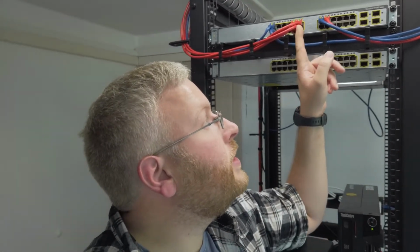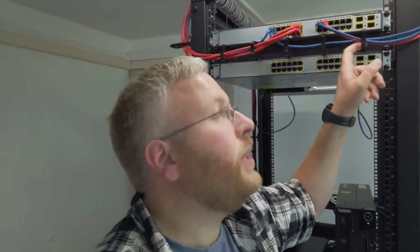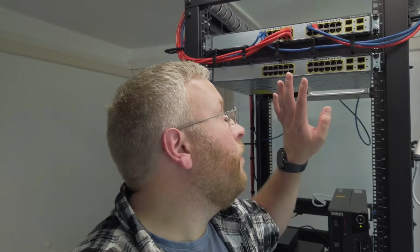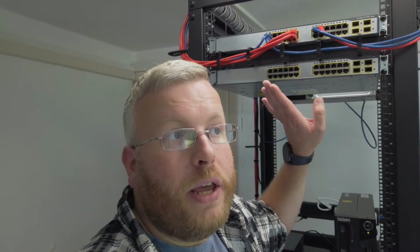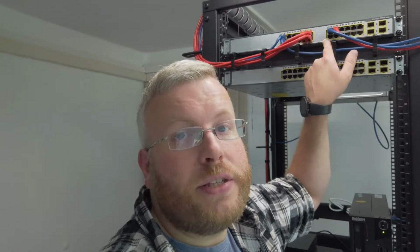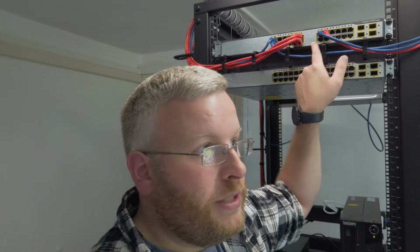These are 2 Cisco Catalyst 3750G switches, which are gigabit switches, non-PoE, just gigabit, just regular SFP, no SFP+, so really old switches, and that is why they have to go. They are both from 2007, and they are really power hungry. I guess one of these switches consumes between 50 and 60 watts constantly without even having load, without supplying PoE devices or anything.